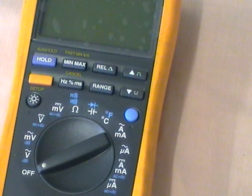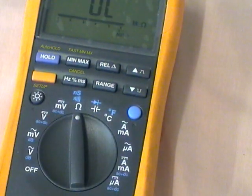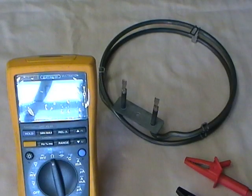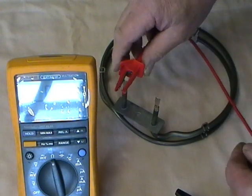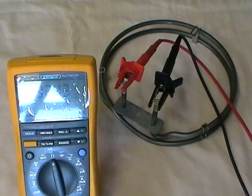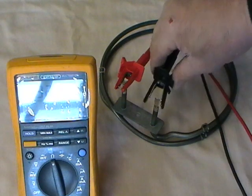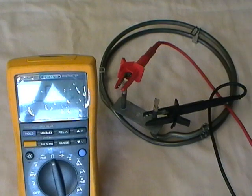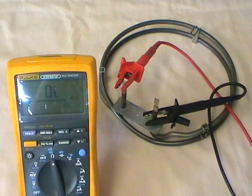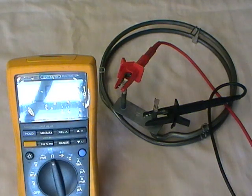To test the element you need access to a multimeter. Turn the scale to ohms and we're all set to test. This multimeter is auto-ranging so if I just connect my crocodile clips up to the two contacts we'll get an automatic reading — that's 32.4 ohms, and that's the electrical resistance of the element. If I then move one of the clips down to an earth position, the element is showing overload, which means the resistance is infinite. That's a really good element.